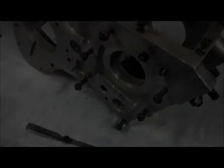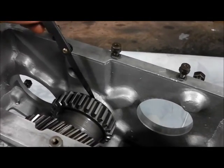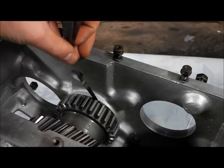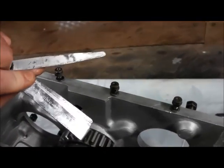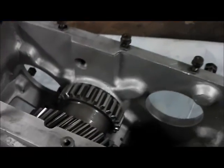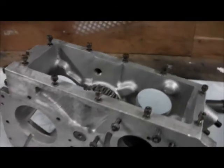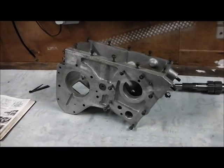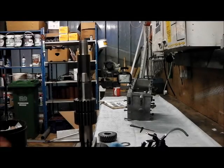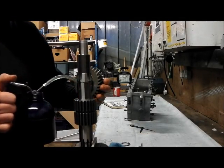So you can see it's a good fit. That's a four thousandths of an inch feeler gauge in there and it just gives slight resistance, so we've got a really good running clearance there. I'm doing everything I can to try and make it a nice quiet box and shimming up seems to be the way to do it. Now we're going to check the end float of the high speed gear wheel — it should be between six and eight thousandths of an inch.